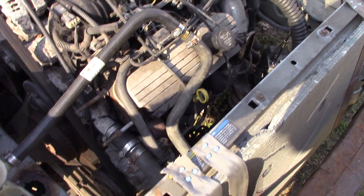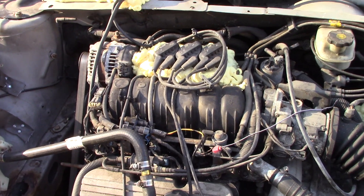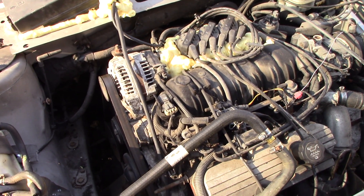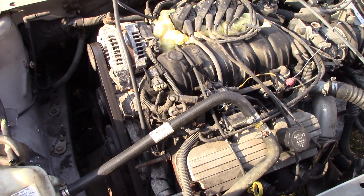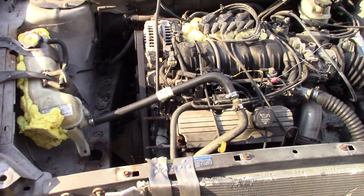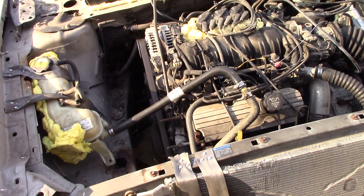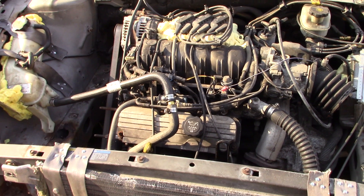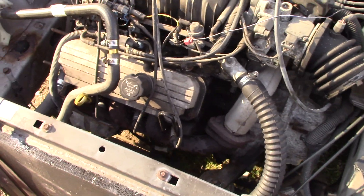That was reason number one to not mess with the radiator. Number two is that we are running a 3800 engine. If you're not familiar with the 3800, it's pretty notorious as a V6 — one of the better six-cylinders for handling heat and running a long time before shutting down, much better than the 3.1 engines most people know from Luminas and Monte Carlos. We've seen firsthand a 3800 engine run in Susan's Lumina during a pavement derby where she lost coolant very early on. It ran the entire time without serious power issues, screaming hot with water draining out of the radiator. This one will at least be a sealed looped system, so hopefully that buys it some time.